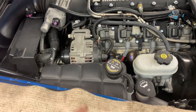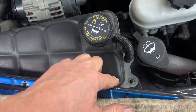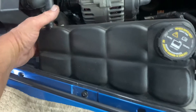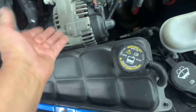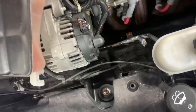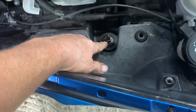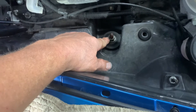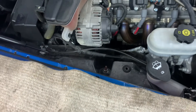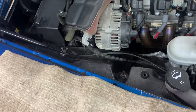During the driver's side shock, you've got to remove two nuts on the coolant tank — there's one there and one over here. Remove those two nuts, pick this end up first and swing it out a little bit, then pick this end up and place it aside. Right there is your upper strut mount. Put some penetrant on it, let it soak in for a little bit, then get your impact and socket on there and get it off.